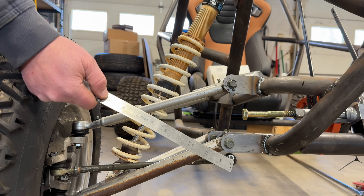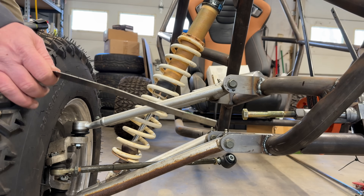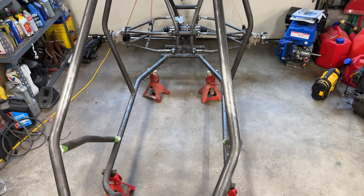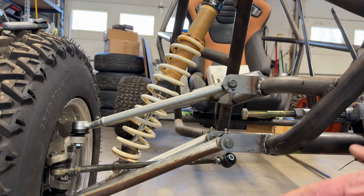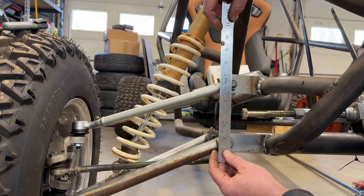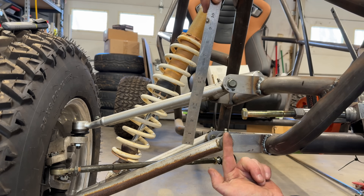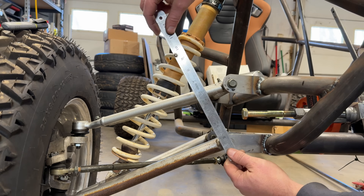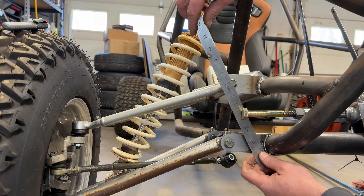Remember you can make this shorter or longer, especially if you have more threads on your output. You may have to special order hardened bolts with more thread on them. Since I'm doing the extended arms, we're matching the front track width to the rear track width, so our tabs are long because the ATV donor we used — a Raptor 660 or Raptor 700R. As for bump steer, because we're making this rack adjustable we can adjust it — a good starting point is to have your tie rod end link exactly lined up with your A-arms.